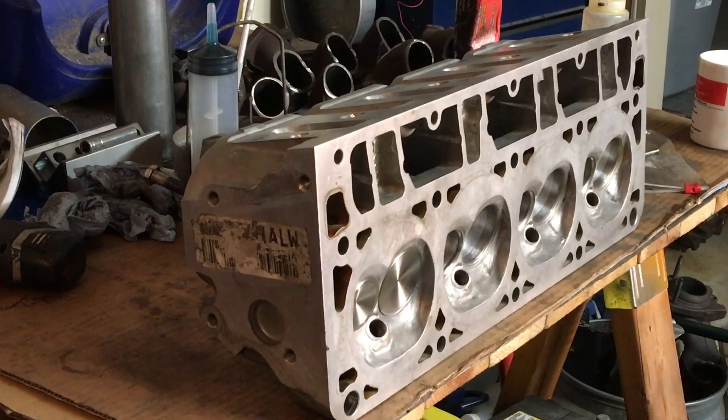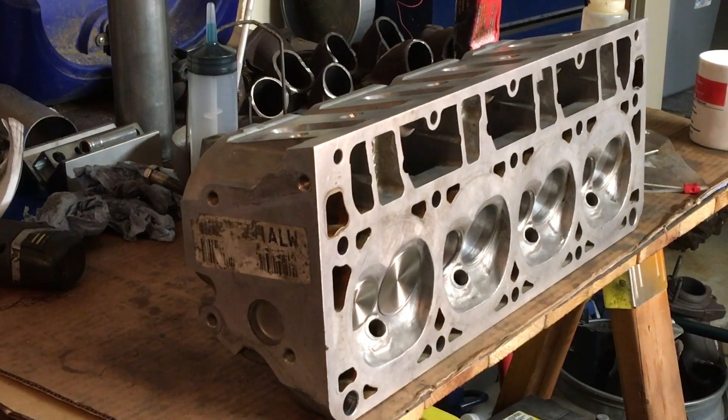Let's try to do this just to see if it works, and it seems to be working — the fluid is still in the intake port, no leaking, no problems. I'm kind of beyond words right now because I truly was not optimistic. Because of all the times we've paid to have valve jobs done because the machine shops told us we needed them — it really makes you reflect back on the thousands of dollars spent. Maybe — and I'm not calling anybody out — that money didn't need to be spent some of those times. We put 20 thousandths bigger one-piece stainless steel valves on the factory seats, lapped them in, and they sealed perfectly.